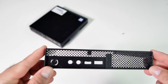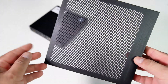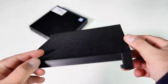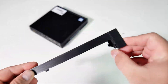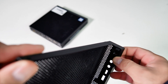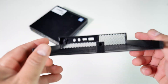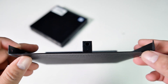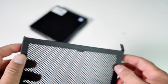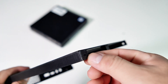Here is the printed case. The first layer that's stuck to the build plate looks very smooth, but the front bezel seems a bit less so. However, the overall print quality is good. I used PETG filament to print this case — it may not be the best, but it can withstand temperatures up to 80 degrees Celsius. If you have a 3D printer with a chamber enclosure, you should use ABS or ASA filaments, as these materials can withstand higher temperatures up to 100 degrees Celsius before starting to soften or deform.